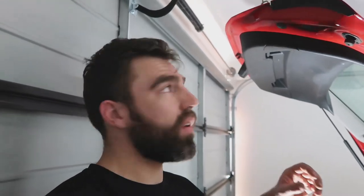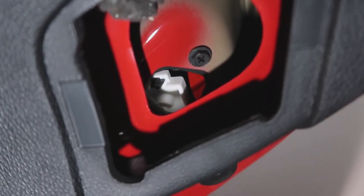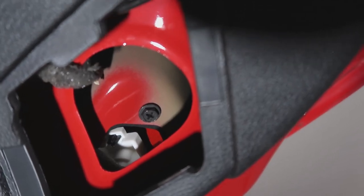To get to the reverse lights or anything like that, it's usually in a cover. That cover just pops off — sometimes with a screwdriver, but in this case with my hands, which is fine. You can see the plug in there and there is a screw just there. Under that screw, which will pop out the light from the other side of the boot, which will allow us to get into that and change that globe.